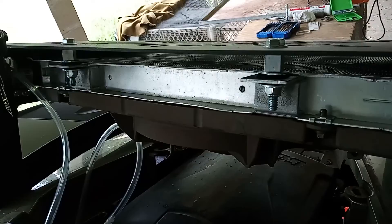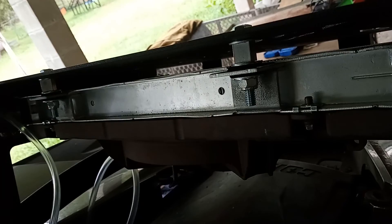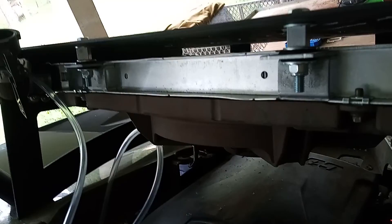The power and relay for the fan — the instructions don't say what to do with them. I think they assume you'll figure it out yourself, and I did, but I want to do something a little different. Also, these spacers did not come with the kit because they didn't send any that fit. You need to have that spacer in there so your radiator and the fan shroud are separated — that way it's easy to clean. I went and got some different bolts for it.